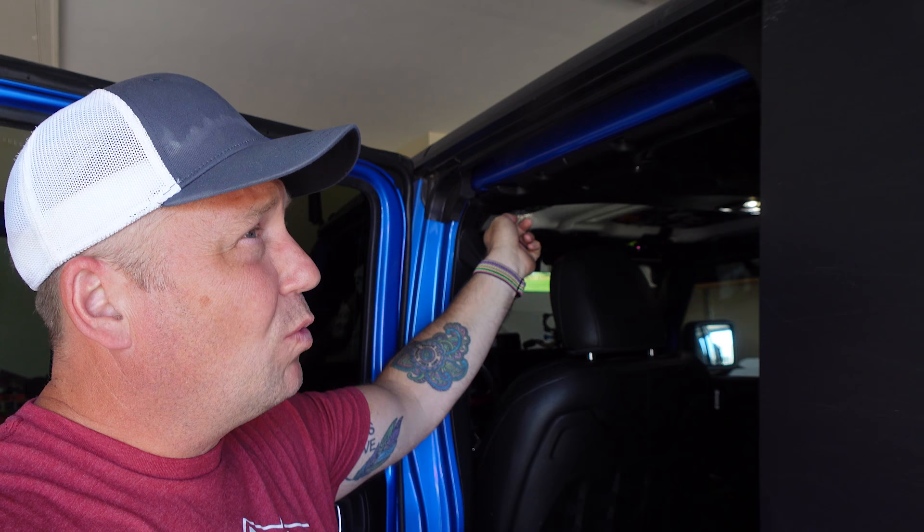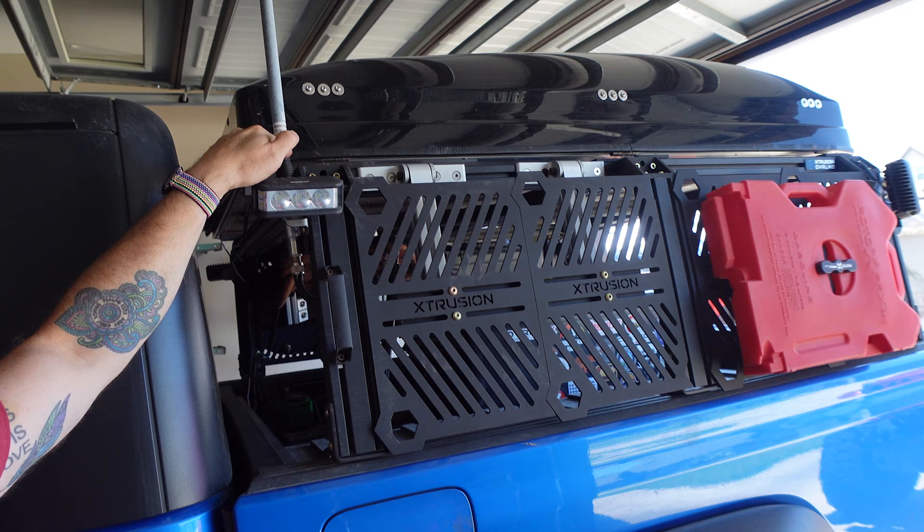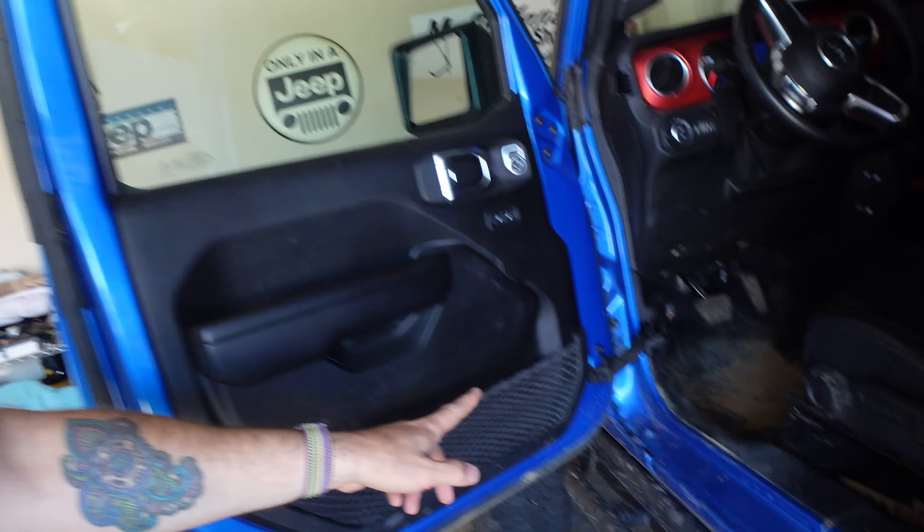It's been six months since I did the initial install and recorded that portion of the video. I tested it for a bit and had some issues. As you may have noticed, the location of the internal antenna did change — I had issues with it being mounted up high; it just didn't work. HiBoost support was actually great. Apparently the plane of the antennas is very important, and it didn't like being in basically the same plane as the external antenna, so I moved it down lower.